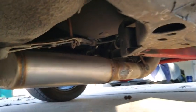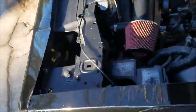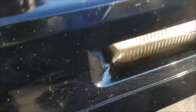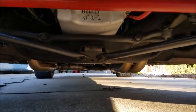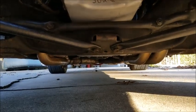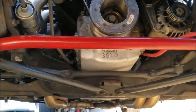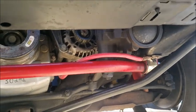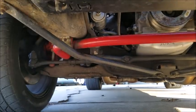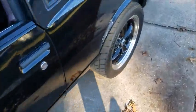Exhaust is dual three-inch pipes, Race Pro mufflers, got an X-pipe in it, and goes up over the axle. UMI performance front and rear solid sway bars. Major change was the Holley oil pan - it definitely helps with clearance; I had the GM muscle car pan and it would hang down, but this sits quite well. Battery is in the trunk so grounds are definitely your friend - there's a ground cable going from the block to the frame. There's the UMI front solid sway bar.